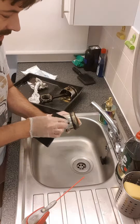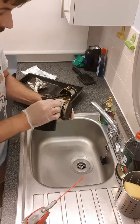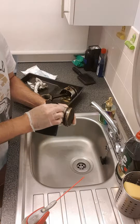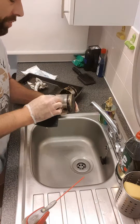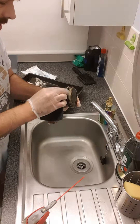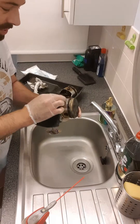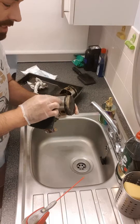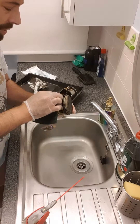Don't worry about the rings on mine, I'm scrapping my rings anyway. I've already gone as far as I might as well go the whole hog really. I thought that the crankshaft was gone because I was worried about the end float. Turns out it's just cheap measuring equipment on my side. There was end float in it — it was towards the higher end. We put in brand new thrust bearings and it's gone in a treat.